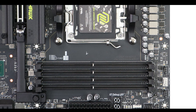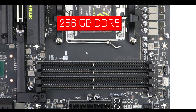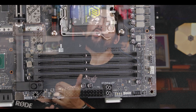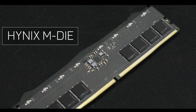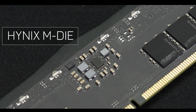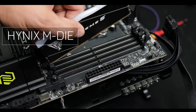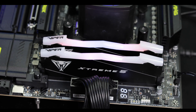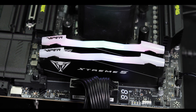Memory-wise, the board supports up to 256 GB of DDR5 RAM, able to swap data up to a very fast 8400 million transfers per second — the same speeds seen on most MSI motherboards lately. However, not all RAM is equal, and to reach those speeds you'll need sticks featuring a Hynix M-Die, a DRAM architecture designed for higher RAM speeds that usually comes at a cost. The best performing, durable, and affordable sticks I've tested are the Patriot Viper Extreme 5, which feature the M-Die and are foolproof to use.